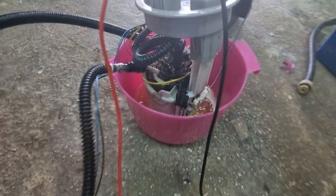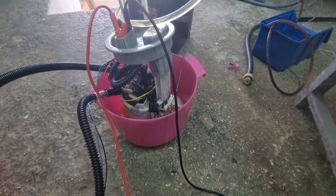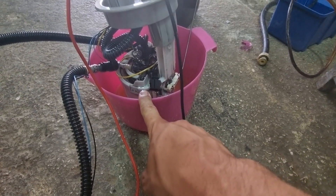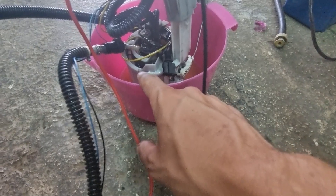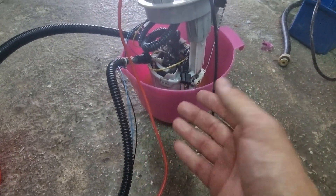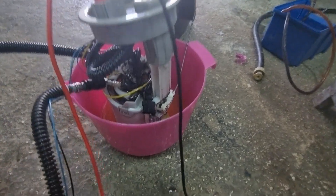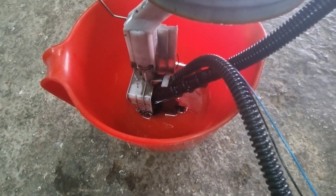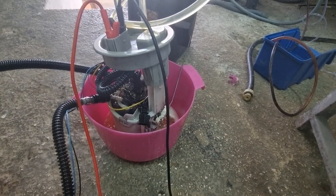I'd also like to mention why there is a check valve in this housing. When you turn off the car, fuel stays in the housing and doesn't go anywhere, so you can always start the car and drive even when the fuel level in the tank is low. The housing is full, that's why the housing is closed and why there is a check valve — so you always have full fuel. When you start the car, fuel is sucked from the housing even if the left part of the tank is empty and the right is almost empty. That is how it works — it's not simple, but it is simple when you understand it.